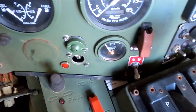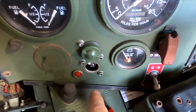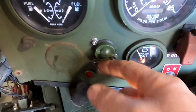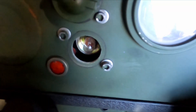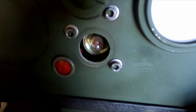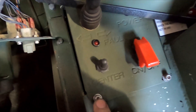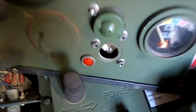Here's how to test it: if your indicator for your bright lights doesn't work and your dash lights don't work, just unscrew one of these covers and you'll see the sleeve where the bulb goes in. Get a test lead, ground it to one of these screws — these usually work as a ground — then run the other end to that sleeve inside there, and the lights will come on because you're giving them a good ground.